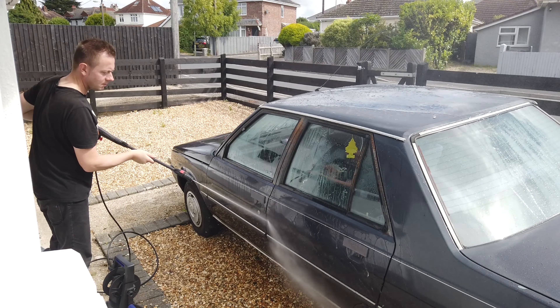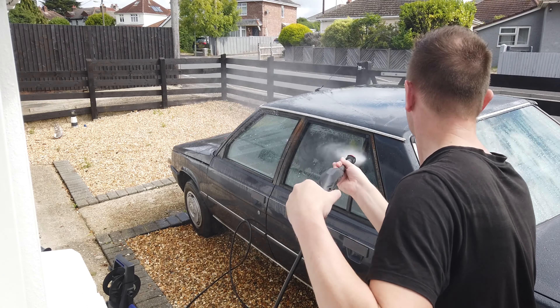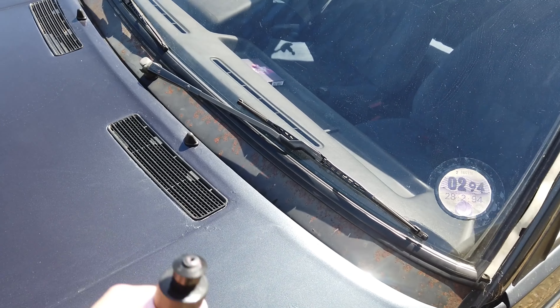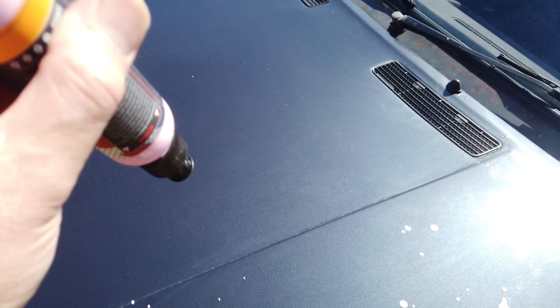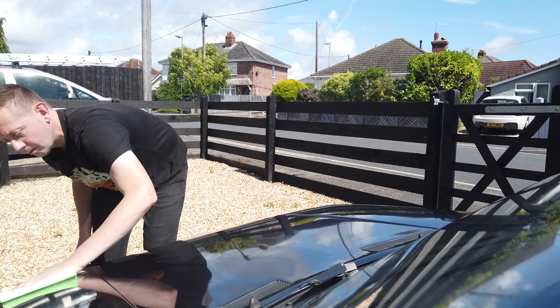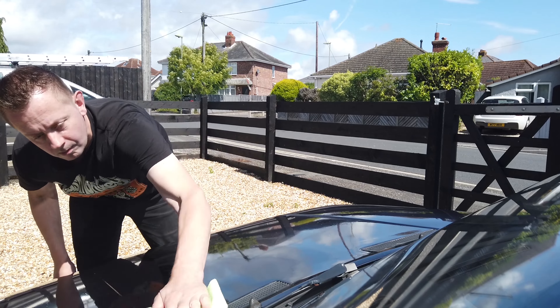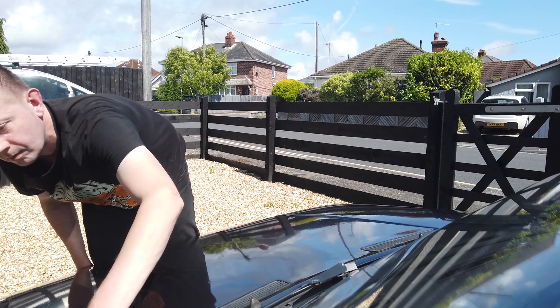So this is the progress so far. The radiator fan is mounted up where it needs to be. I've still got two more pins to put through, and that electrical plug is going to need to be cut off. Then I'm going to use the wiring that's in the car and connect it to that, so I can disconnect it without having anything hardwired, which would be nice. Coming along. One thing we haven't actually done yet is clean Claude, so let's give him a good wash.